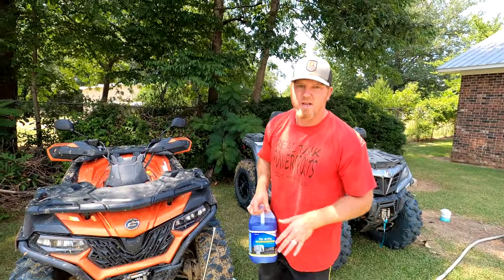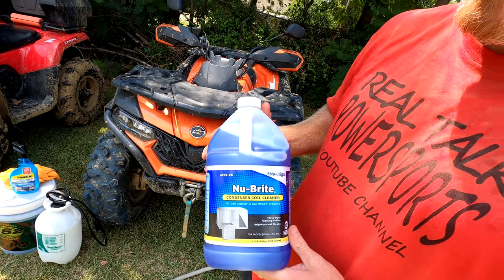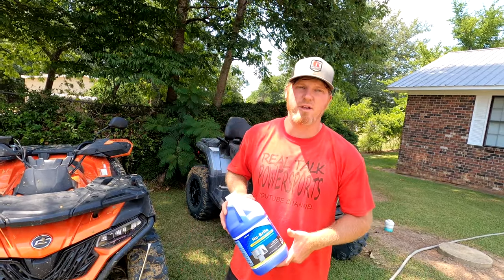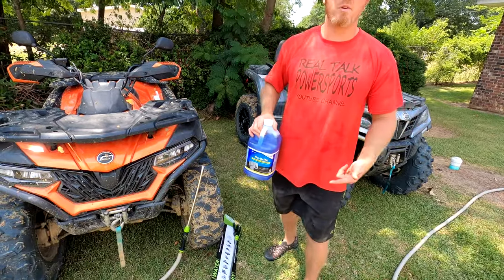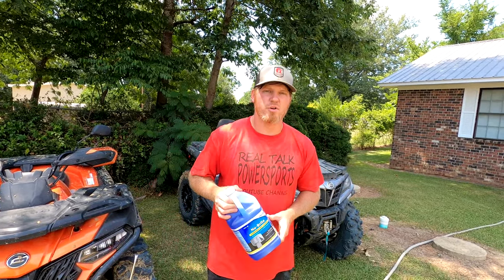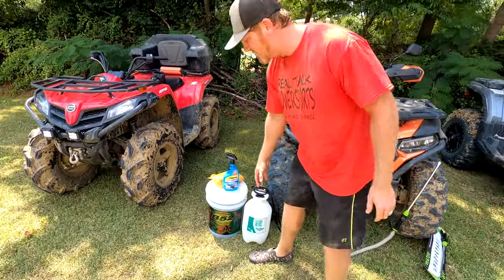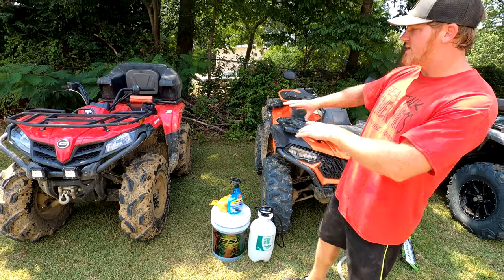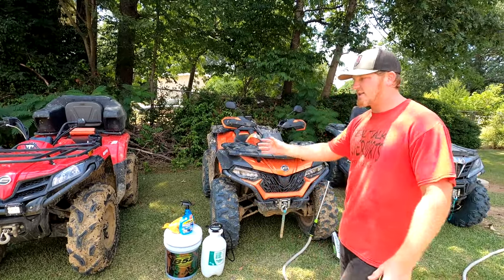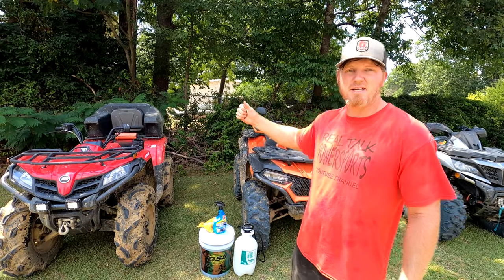I don't really intend to use this today, but I'll do a video on it — we have some condenser coil cleaner for when your radiator gets really bad. You have to be careful using this; I haven't seen it hurt any plastics, but you don't want to leave it on your plastics very long at all. We're going to try not to have to use any chemicals, so all you need to buy is one of these Radiator Genies. We also have this B-52 — it's a really good degreaser. We're going to put it in a pump sprayer and just put a little coat on each one. It's not supposed to hurt the paint or the plastics, so we're going to try it out and see if it will eat that dirt away.